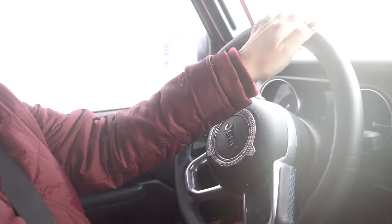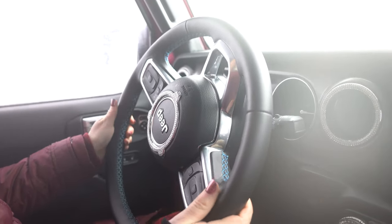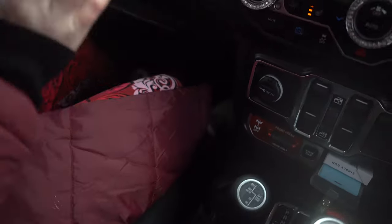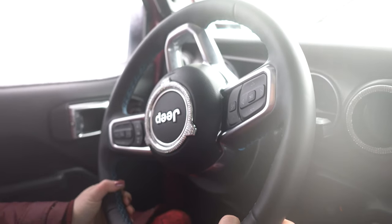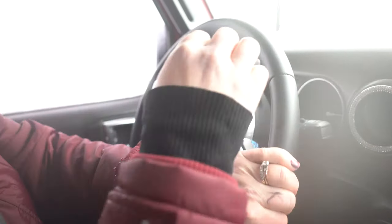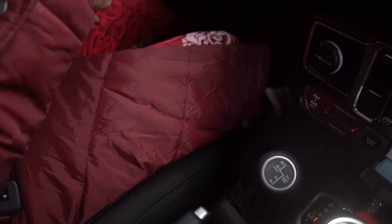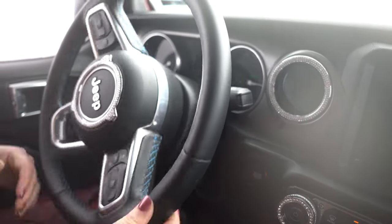Right now, as you see, we're doing figure eights in the parking lot and it's basically perfectly effortless on the steering wheel — no binding, no chattering like you would get in four-high part-time. Now let's put it in four-high part-time, Amanda, and do the same figure eights. You can already feel the Jeep chattering — it definitely doesn't feel as effortless as it was before, because now we have a much more aggressive lock between the front and the rear. So part-time would be for off-roading on rocks or mud where you need it, but really in the snow all you would ever need is that full-time four-wheel drive to get you the maximum traction.